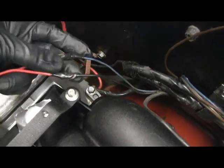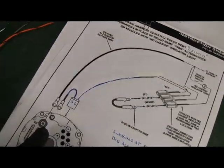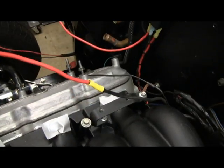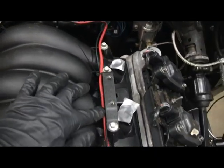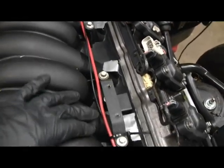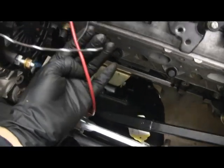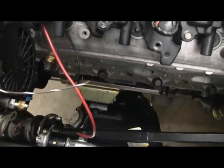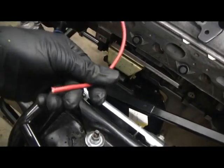Here's the old connector to the alternator — you can see the blue and the black wire. Tracing this back through the mess of connections, I'm going to terminate the blue and put a new wire onto the black. The other wire we need is the main charging cable — this mess right here is it — so I'm going to cut this off and splice in one complete piece of wire. I routed the wires for the alternator up on the inside of those brackets for the fuel rails, just wire tied on temporarily. I'm going to run the wires up underneath and into my pigtail. The brown wire with the white tracer goes to the black wire for L, and then the gray wire goes to the charging terminal. The red wire will also go to that charging terminal.